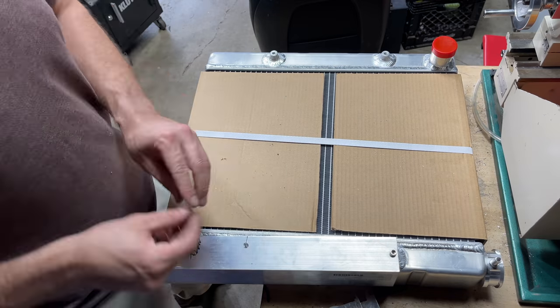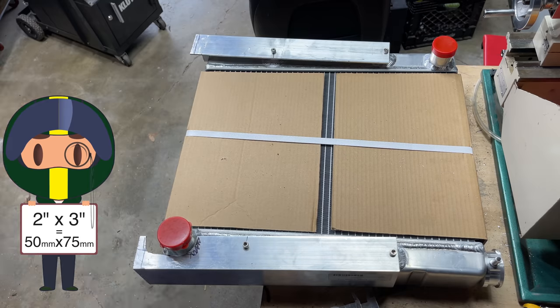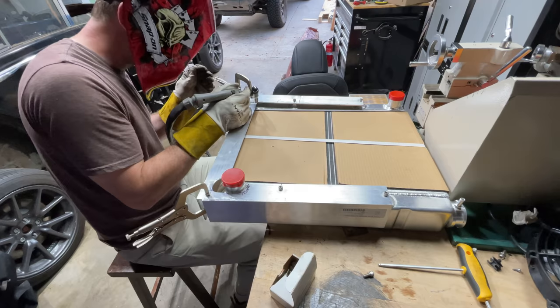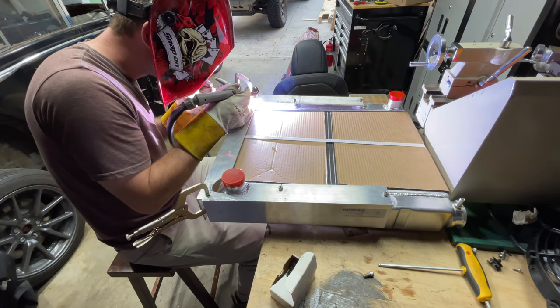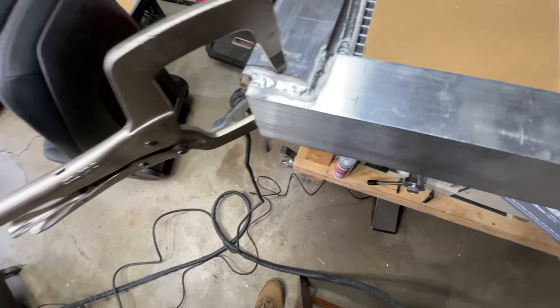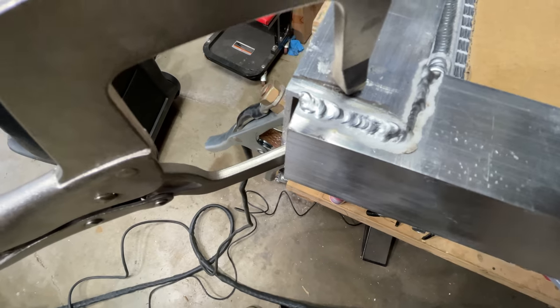So let's mount a radiator. I'm going to weld up an aluminum stand for this, making it out of some 2-inch by 3-inch aluminum angle. If I put four bolts at the bottom corners that should constrain it pretty well. I'll probably also add a triangulation support back to the frame to add some rigidity. Triangles are great — the engineer's best friend. Super efficient. Well, I would say for an engineer, above average.